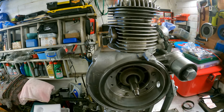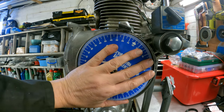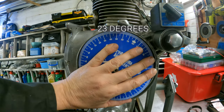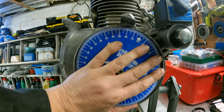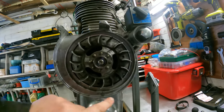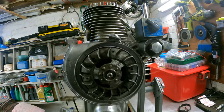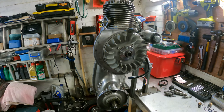That then allows us to put the timing disc on and count backwards to where we want our timing to be. I've got my disc on with top dead centre at the top, going backwards anti-clockwise. I've put a little mark there already, and that's my timing mark that I'm going to set the stator to. This was the original flywheel and somebody had marked TDC before — the arrow points here — but because we've changed the flywheel and set TDC with this other type of flywheel, that will always be a mark there for top dead centre to mark off of. So that's the stator and flywheel done.